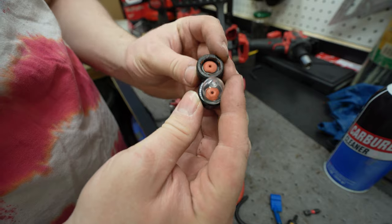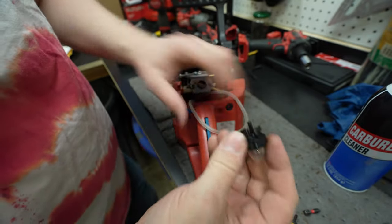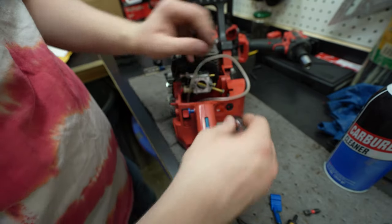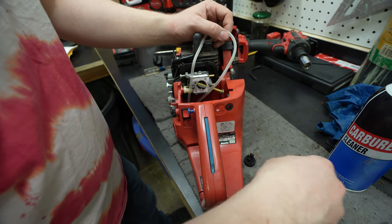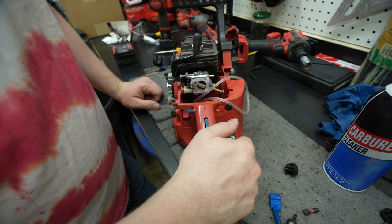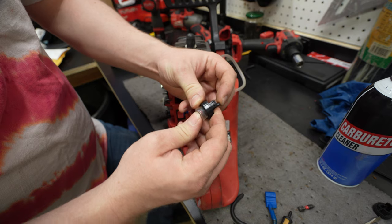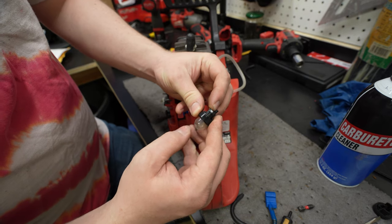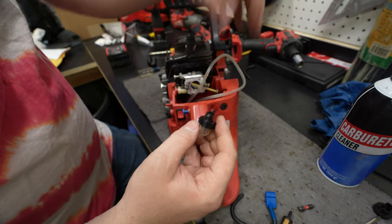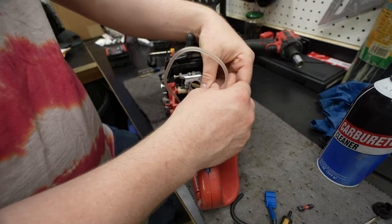Also, from Jack's small engine, I was able to get a new air breather, or what is it called? It's to get all the air out of the line, so you can sit here and pump this until there's no more air. So we have a new one of those. So it's just, let's get the tubing correct and go from there. Looking at the diagrams and looking at this, if I put my thumb there, it's hard to push, and that's hard for it to retract. So this is in and that's out. So what we need is an in from the gas tank.